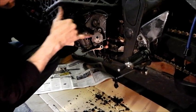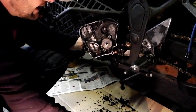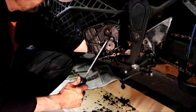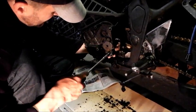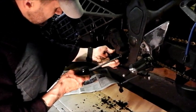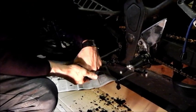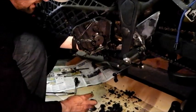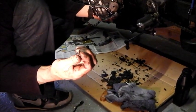Now the next task: you've got two screws there and this retaining plate has to come off so you can get the cylinder out. Normally these need an impact driver, but I lent mine to someone and never got it back - as is the way with things. So I've just got to use a big screwdriver. As you can see from the swarf, there was no way that was coming out for love nor money. So I've had to drill both the heads off - basically drilled down the side and took it out by hand. I'll get a couple of new ones out of the bolt box.